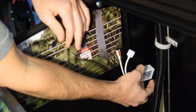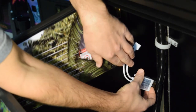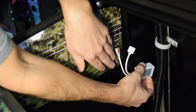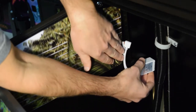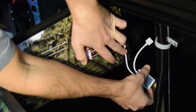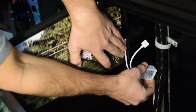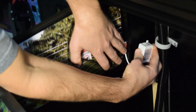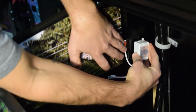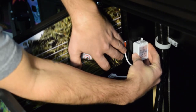Remove the backing from the box and sensor and mount both to the cabinet. If there is not enough clearance for the cables on the side, you can also mount the box to the back of the playfield backboard and run the sensor through an opening in the backboard. Try to avoid running the sensor over the top of the backboard as this is a definite pinch point. You can see here that I decided to mount the box with the plug for the power brick facing up, just to prevent the power cord from accidentally falling out since I have a shaker motor installed as well.